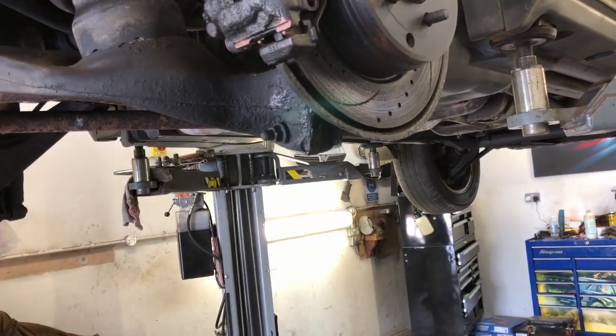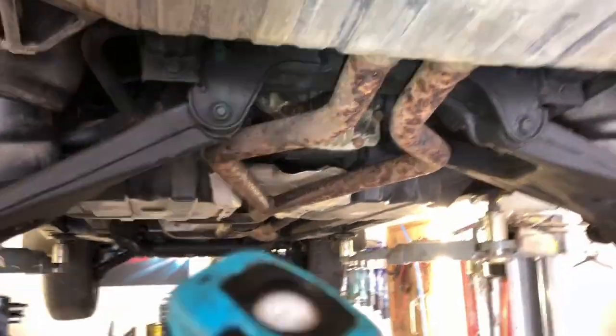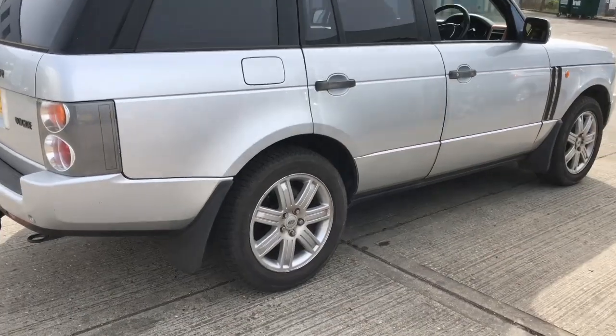That's pretty much it for today. I've done most of the hard work from underneath. It'll get an oil and filter change, a full service — it hasn't been done for a few years but it probably hasn't done the mileage. You can just see it's been standing. I think the underneath now actually looks as good as what's above. A lot of hours — you've got to wire brush it, paint on the rust preventative, then paint it — so it takes three times as long as it could. I have bled the brakes but I haven't actually checked them yet, so I'm still prepared to have to re-bleed them — I've only bled the rear so far.